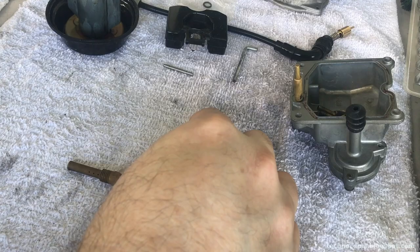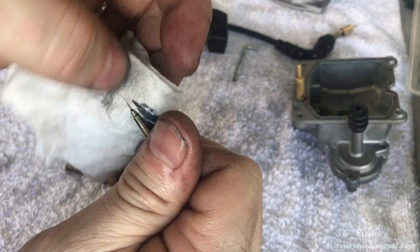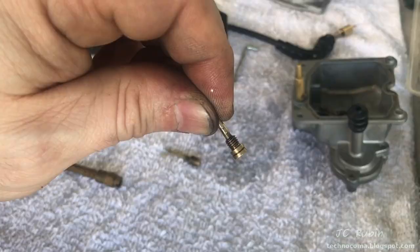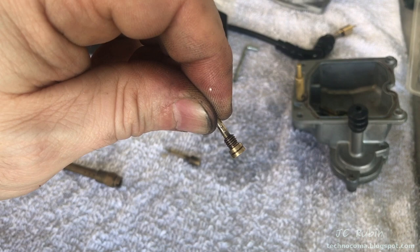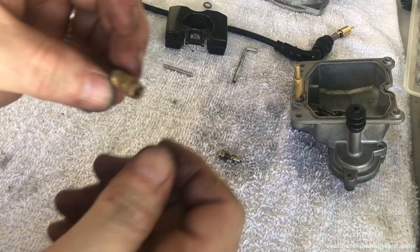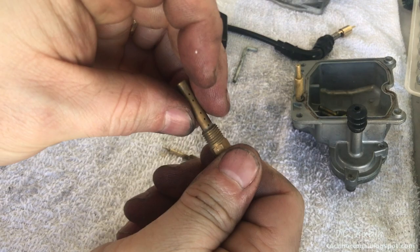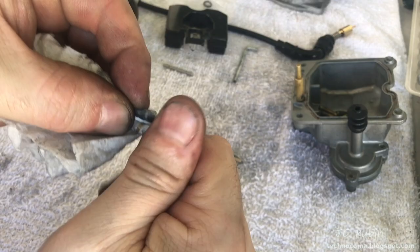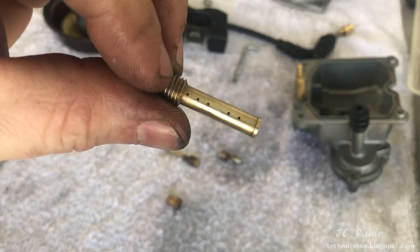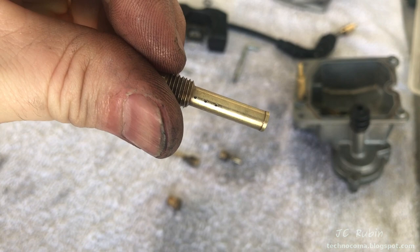Here's the idle mixture needle being cleaned using a turning motion, as I don't want to break the needle tip — it's very fragile. New parts were ordered to replace the missing washer and o-ring. The same technique is done with the jet using polishing paste. Once cleaned, I take some carb cleaner and blow through it from the back and sideways, inspecting visually to make sure the holes aren't obstructed. Separating the jet from the emulsion tube, cleaning it off — if the inside was dirty I'd also use polish with a pipe cleaner. Everything is blown out with carb cleaner, confirming no small holes are closed or impacted.